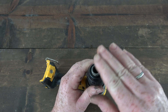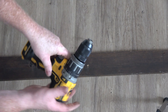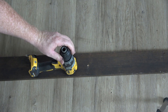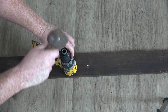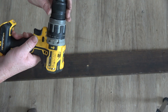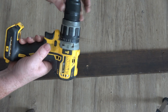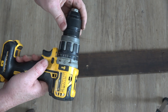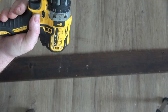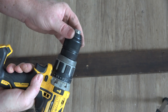There's still a little bit of a gap, so I'm going to tap this back into place. The camera's on the ground so it looks aggressive, but these are pretty light taps — I'm not trying to hit it very hard. You can see it's pretty much sitting in there; I'll just give it a few more taps to make sure. And that thing is pretty much like it was before I took the old chuck off. This chuck is solid — it feels really nice, and I still got that little bit of play for the hammer drill action.